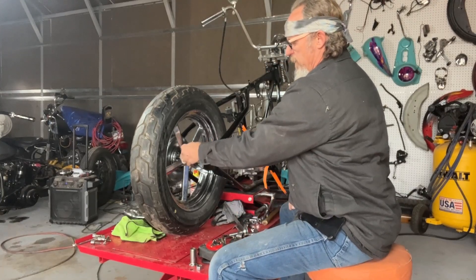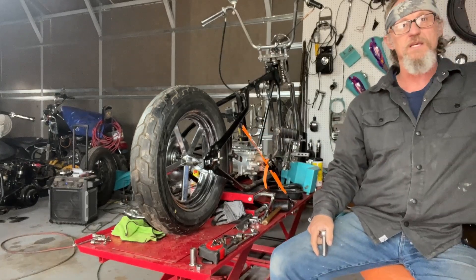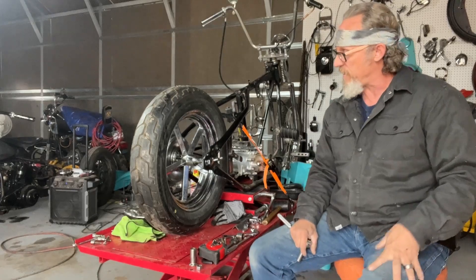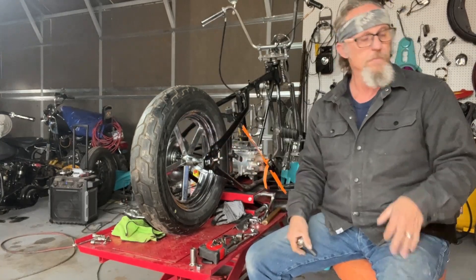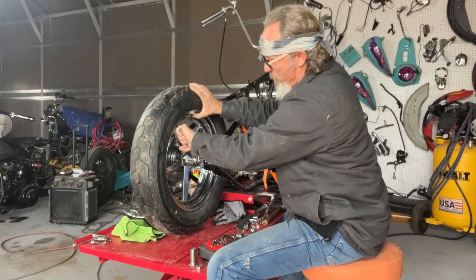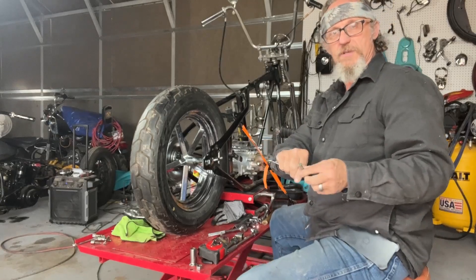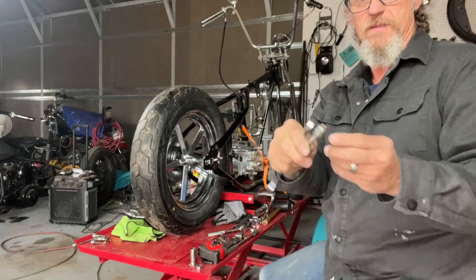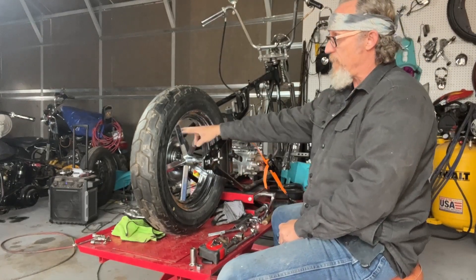We're trying to pull the Invader wheel apart. I'm trying to get the mechanical brake system to fit on this Invader wheel. What I'm going to have to do is use a juice brake drum and sprocket with the mechanical brake backing plate. My issue is there's no bearings on this side of the wheel in the mechanical brake setup — the star hub has got a different bearing assembly. To be able to use this Invader, I've got to have the bearings in the hub. It's been a real nightmare.